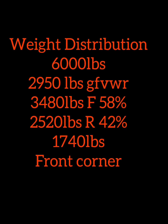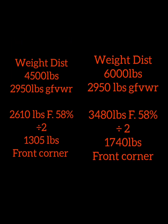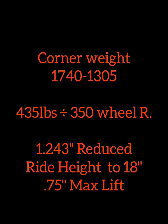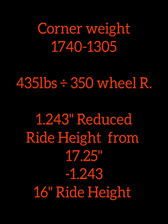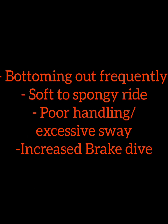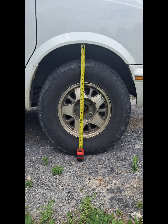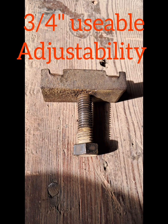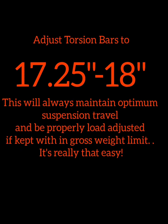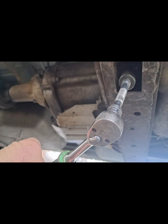Let's look at our two-inch lifted van, but add 1,500 pounds. This now puts us at the 6,000 pound gross vehicle weight rating. Using our established wheel rate, we can simply look at the front corner weight difference to see what our new ride height will be. The added weight has reduced ride height by one and a quarter inches, but has maintained a three-quarter inch lift and also a more factory-feeling ride at gross vehicle weight rating. Now let's look at these same numbers, but say you start at factory ride height and add a lot of weight — you're now at one and a quarter inches below factory ride height. All of these examples show how much effect weight has, and that the purpose of adjusting the torsion bar is to adjust for load to maintain a certain ride height. Setting your torsion bars to this ride height is a good starting point. Going farther, we can see just how much small increments make in ride and handling, and use them to our advantage — and why no one specific ride height is perfect for everyone.